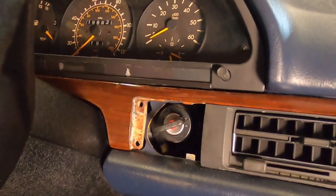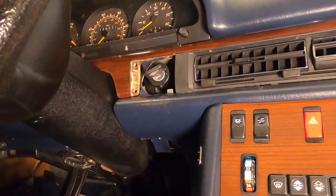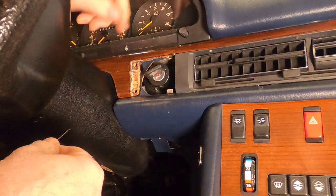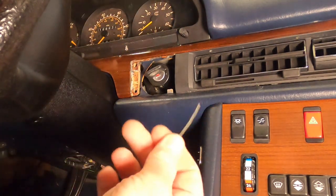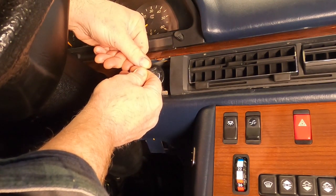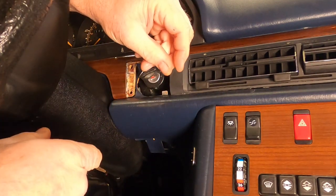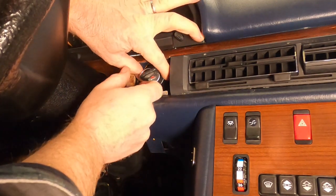I'm going to set the camera down and take this cylinder lock out. Pardon the dustiness — these modern cameras pick up every little defect in your automobile. I've already removed the cover, so we'll put that back on when we're done. I've already got the key in the accessory position. This one is starting to stick pretty bad, so I was paranoid and left it there until I could make a tool. I'm going to slip this up in there — you can feel it get right there, sliding past something, and it gets a little harder. Once you hit that hard part and go maybe another eighth of an inch, you should be able to start unscrewing the cover.